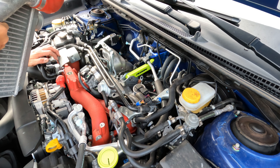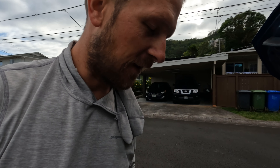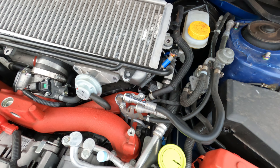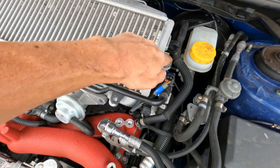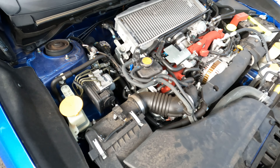Getting this Y hose back onto your turbo is the most difficult part of this install. Little tip when you're trying to put the intercooler back in: it's very difficult to get that Y pipe back onto the turbo, so I took off the right bracket, and that gave me a lot more wiggle room to get the intercooler in there. Gotta have a little bit of patience and you'll be able to do it. All right, that's it — had to take the shirt off for that one. Getting that intercooler back in with the Y tube onto the turbo was the most difficult part of the job, but persistence — don't give up.